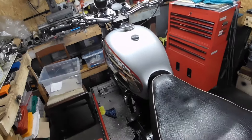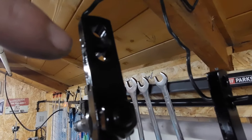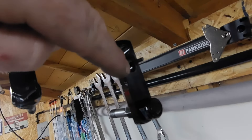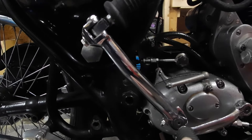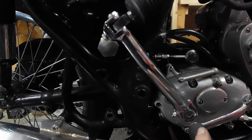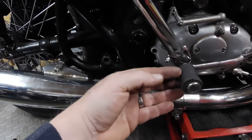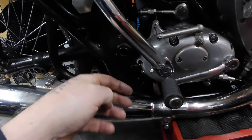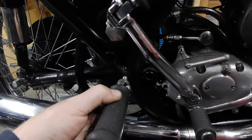I'm going to have to ride it and see how it feels. I've just taken the rear sets off because I want to put another mounting hole for the peg — slightly lower, but still on the rear set — just to give more room for the gear lever. It was just a little bit cramped up there with a more upright riding position, so moving it down a little will give a bit more space.